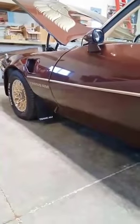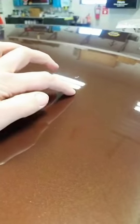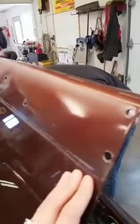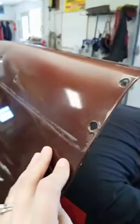So more marks for body alignment. I mean, if you're 20 feet away from this car and I hadn't written on it with a pen, you would never see most of this stuff. When you get really close you can see all these little speckles - that's all dirt in the paint that should have been sanded out when it was being wet-sanded and buffed after it was painted this last time. But they didn't do it that way. They also didn't remove that spoiler that is now on the floor, so there are at least two layers of paint up here in front of it and behind it. They just left exposed primer on the deck lid there, and we do have some rust coming through on some of these holes.